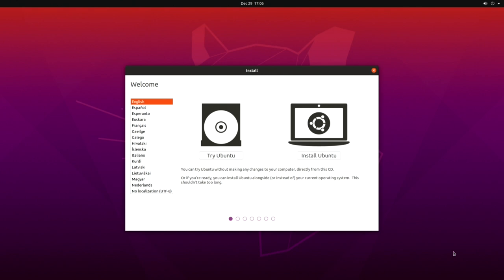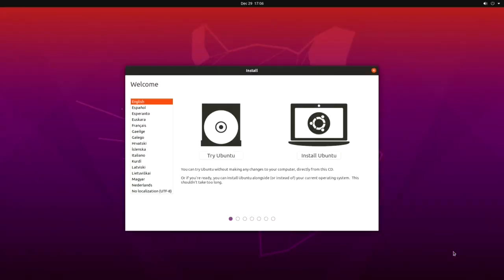I installed two OSes — Ubuntu and Windows 10 — since I'm a royal noob at Linux and it's been about 20 years since I've touched it. I installed Ubuntu first and then split the SSD in half: 256 gigs for Linux and 256 gigs for Windows. The 256 gig Linux partition will be readable by the Atari VCS, but not the Windows partition. You don't have to split the SSD, but I plan on installing Windows 10 onto the free partition — I'll go into what problems I ran into in a bit.